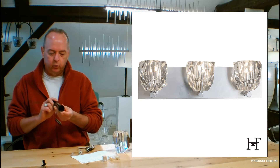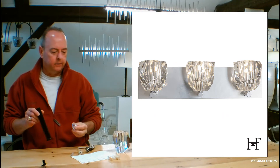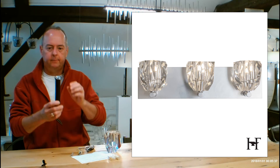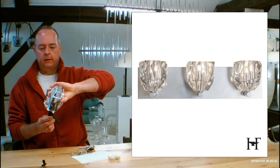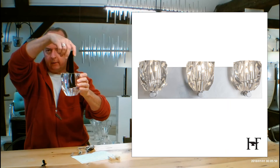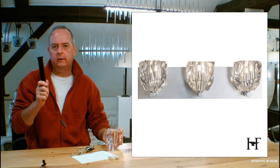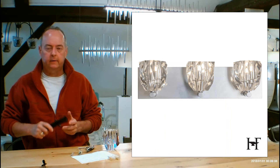This is a tool that's going to be in the parts list, and this is going to be a retaining cup, also in that parts list. To put the glass on: once you put your bulb in, you slide your glass down on top. What I would do is take the retaining cup, put it inside, take the crystal and hold it so the cup doesn't slide out, then lower all of it together. You use the tool as a proxy for your hand that can't fit inside the glass. Once you're done, take it out — the retaining piece holds it all together. Then put the tool away in a junk drawer and forget about it until you need it in the future.